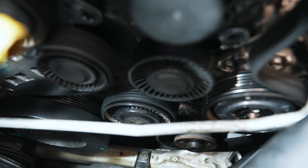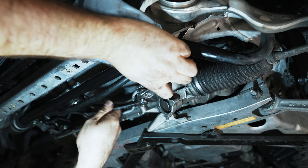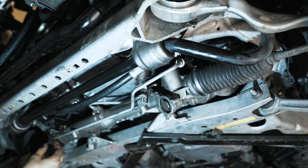That concludes the work from up top. Now get the car jacked up, go underneath, and remove the splash shield. I have my E12 socket on the power steering pump bracket bolt — there's one there, one there, and one on the side. Going from the front of the car between the intercooler and the front pulleys, use a 10mm ratcheting wrench once you crack those free. There's just enough room to get a ratchet in to release that last bolt, and I removed the active steering electrical connector by reaching behind.